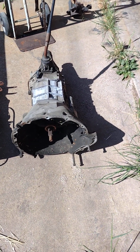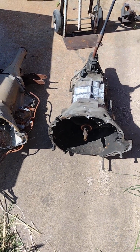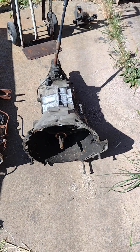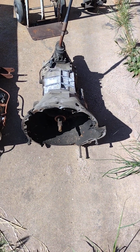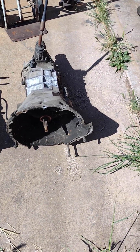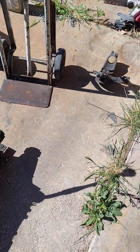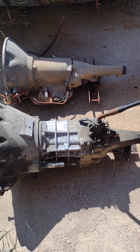Because in the 90s, Chrysler didn't make any cars with V8s, all the V8s that are manuals have heavy, bulky flywheels, because they're designed for towing, for trucks, that kind of thing. So this one is the V6, and it's basically the exact same size as the old V8 flywheel. And there's all kinds of good stuff available for the V6s. You can get competition clutches and that kind of stuff for them. I already have a clutch. I went with a generally traditional style, just for the price point, and I don't want to chew up my flywheel.